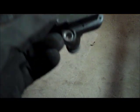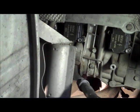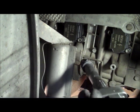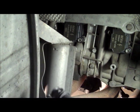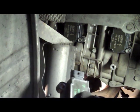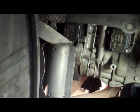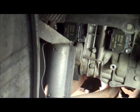Also, when you are pulling out the coil here, as it's coming out through this area here, just rotate it and it'll come out of the hole. You need to get clearance from this top section, the plug receptacle, so that needs to be rotated out of the way in order to pull that all the way out. So that's kind of the trick to getting on the last bank.